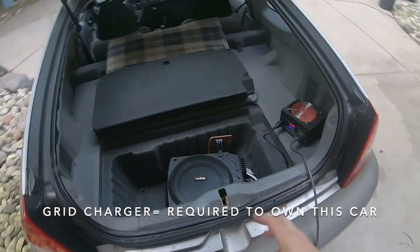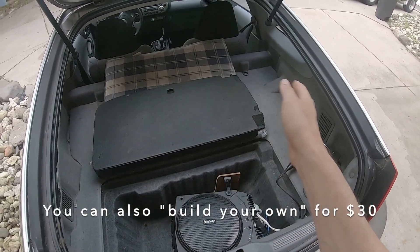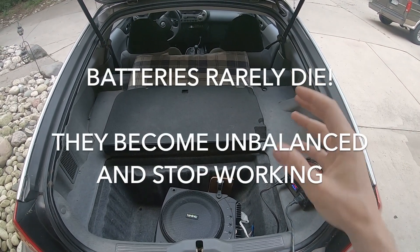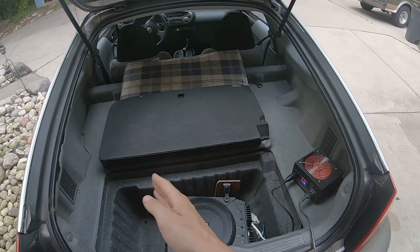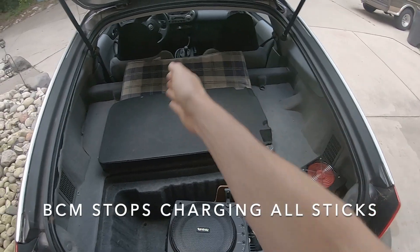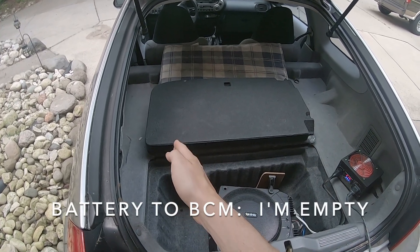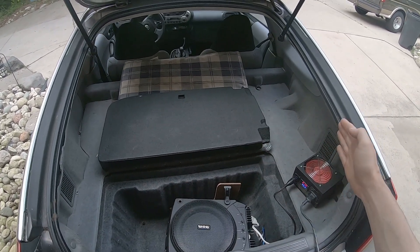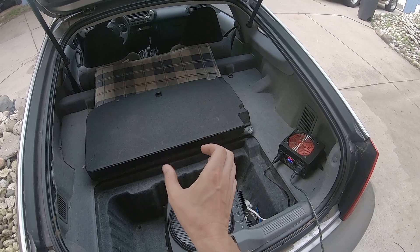The secret is getting a grid charger. These are like $200 to $400. They basically trickle charge your battery and get them all balanced. What goes on with these things is they have a bunch of little batteries and a battery controller — like a battery ECU — and they get what people call out of balance. Just because this is a first-generation hybrid, they didn't have it totally down yet. When one battery gets completely full it'll say it doesn't need any more power and it'll cut power, but it won't keep charging the other sticks which might need more power.